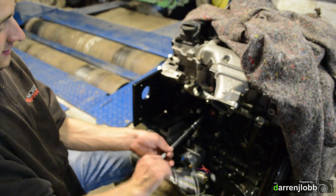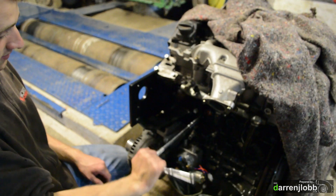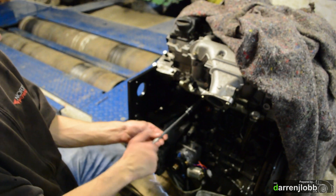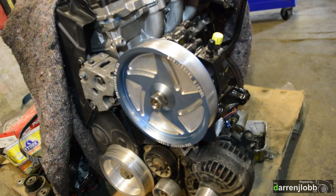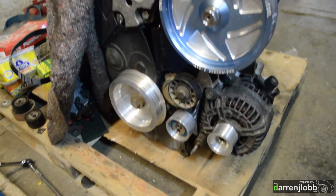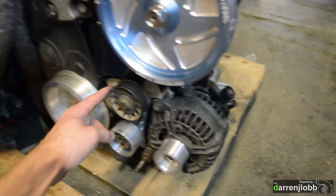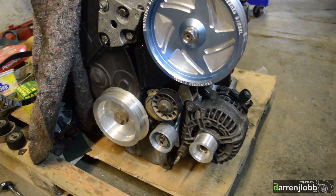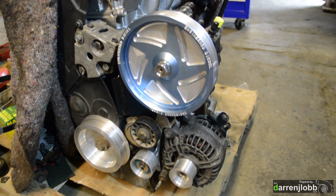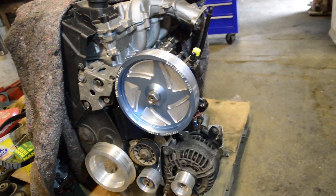I'm just giving it a quick lick of paint and we're going to bolt this up now for the final time. It's got some nice new bolts and washers to make it look a bit tidier, and then I'll get the pump mounted up. All the pulleys are pretty much mounted up how it's going to be. We had to make an adjustment to the spring tensioner pulley - I didn't have quite enough material hogged out the back of the pulley and it was grinding on the actual tensioner arm, so just having that one machined out a little bit more. This isn't the alternator I'm going to be using - it's just one I've been using to mock up. I've actually got a new one to put on here but while I've been messing around I've just left that one on there. I think that's it for this video.